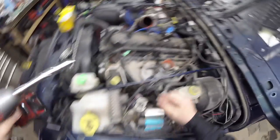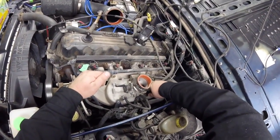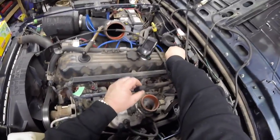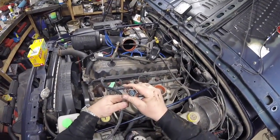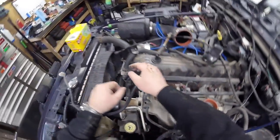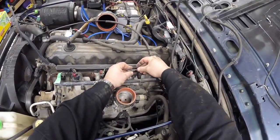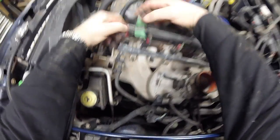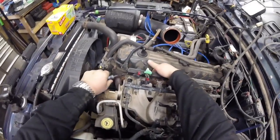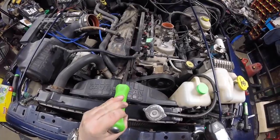Got to get my sausage fingers in there — carefully take that bolt out. Pull this... oh, that's tight. Pull that vacuum line off, turn that out of the way. There's an electrical cable up here — this one connects to an O2 sensor down below, and this one connects to something I don't have on my Jeep. Injector harness — I should just pull up. I'll try a hook tool to get underneath there. Pry bar method, prying off of another bolt.